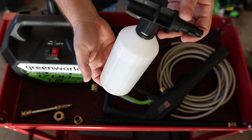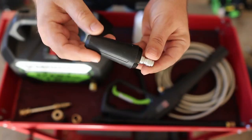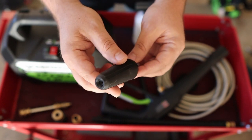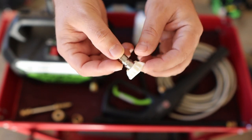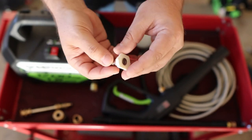Comes with a soap dispenser — not really a foam cannon, but a way of getting a little bit of sudsy soap on the car. We're going to find out how well that works. With the turbo nozzle these work really good for cleaning driveways and houses, but I would not use this on a car — maybe a really dirty tire. Then there's the 40-degree tip, which is never stamped. Between Ryobi, Greenworks, all these companies, you never know what size it actually is — you can guess by testing other sizes and seeing if you get the same PSI.